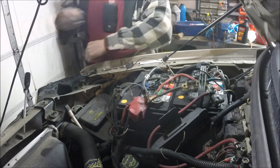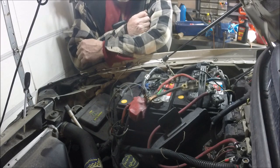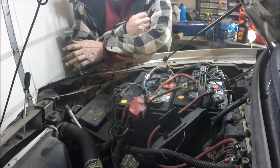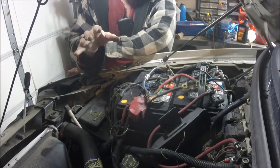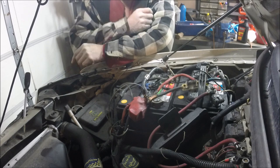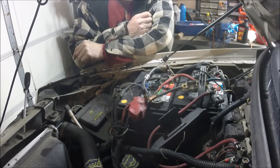I'm doing this because I'm putting in a mass air flow sensor. When you do that, or when you take the throttle body off and clean it, you're supposed to reset your computer. After you put your new mass air flow in, leave the jumper on for ten minutes or more, then put everything back on. When you start it, let it run for about ten minutes, then take it out and drive it slow at first, going through the shifts, because the computer is going to relearn the shift programs — one through five.